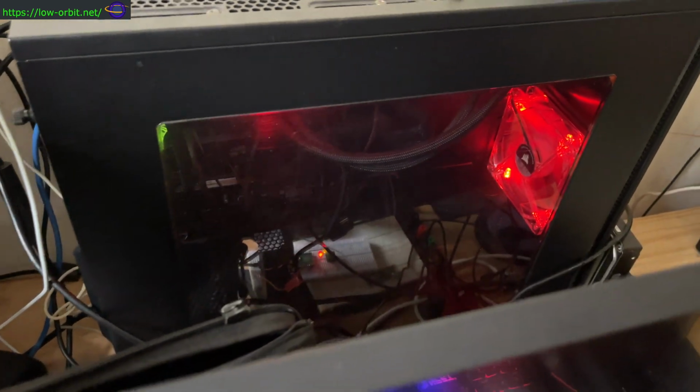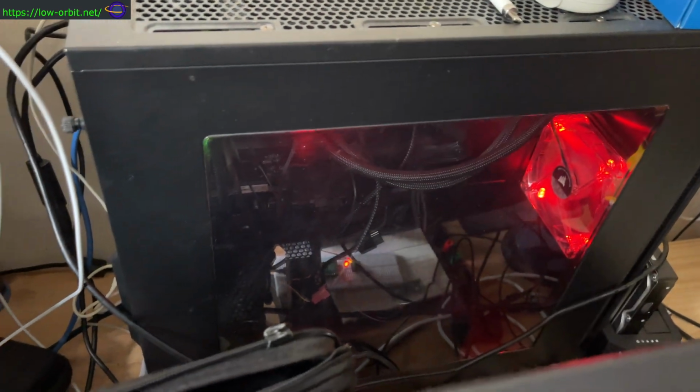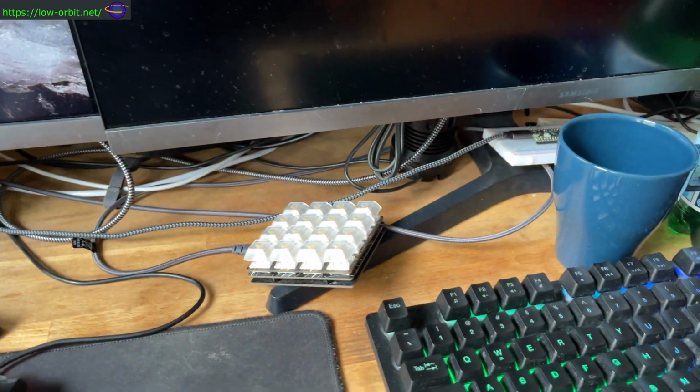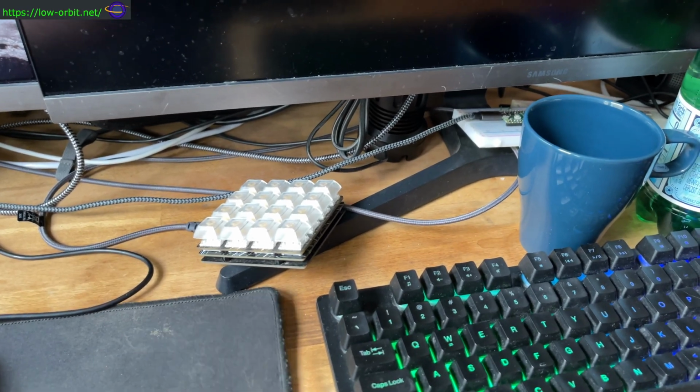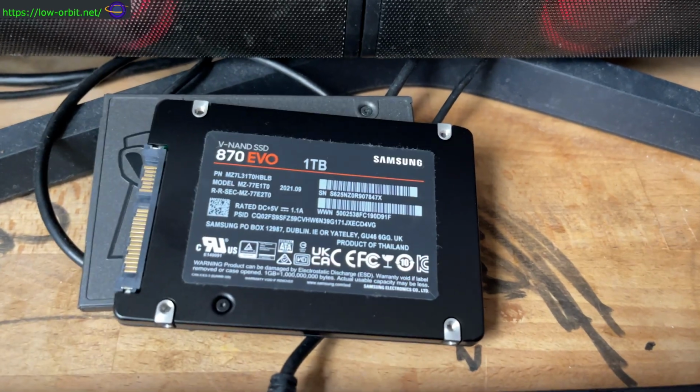I just did that recently. I did some file recovery for my wife's PC, which just died, and I was recovering her files for her. I was able to just clone the drives and mount them and access everything on the system. You can also boot those drive images as virtual machines, so good chance I'm going to be doing that too.